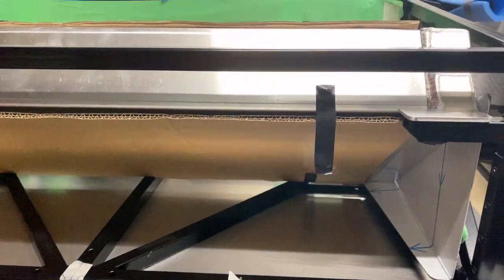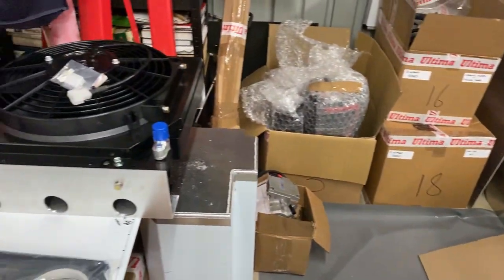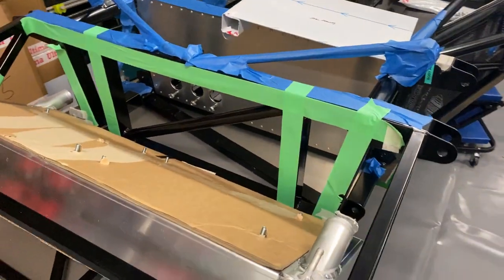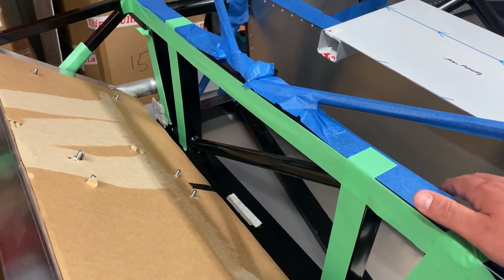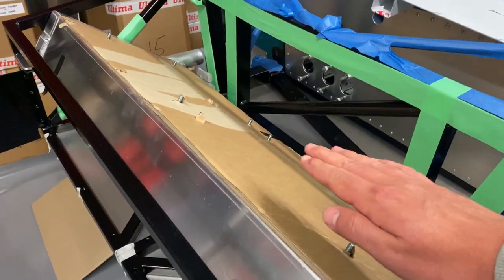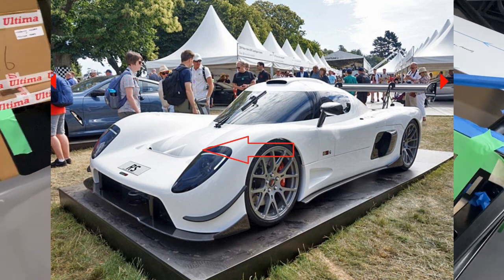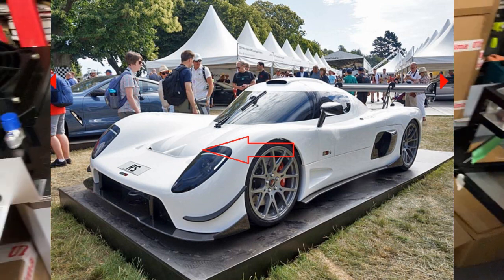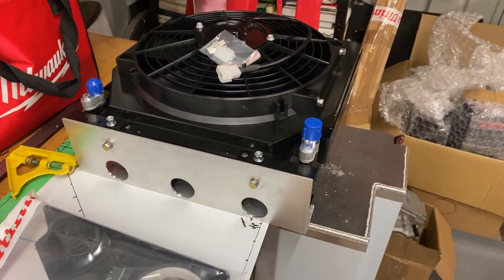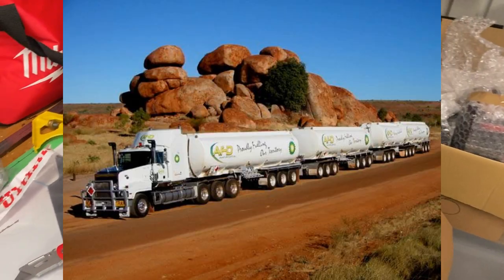It's a pretty tight fit as it is. We need to make sure we're not restricting flow to the radiator, and it needs to go on the front side of the radiator. Condensers by definition are more sensitive to the air-on temperature than the radiator, so I can't just tag it on the back. I also need to look at temperature build-up where the battery, steering box, and brake master cylinder sit — airflow is meant to come up and out through the front clip. First step is to disassemble this condenser assembly because I won't be using that fan or these mounting plates. These condensers are actually designed for industrial machinery — usually installed in cabs of big cats or prime movers.